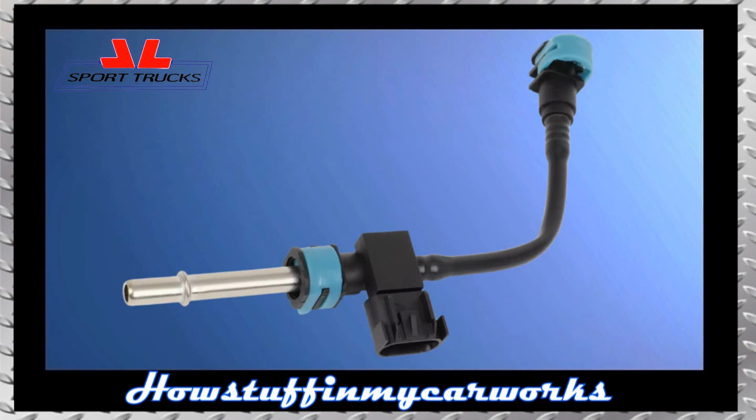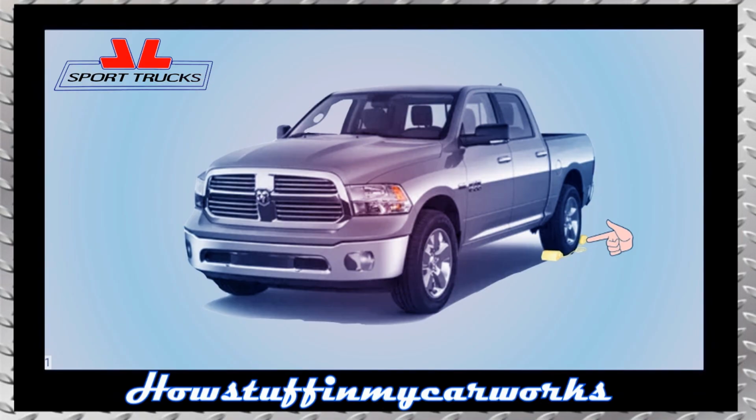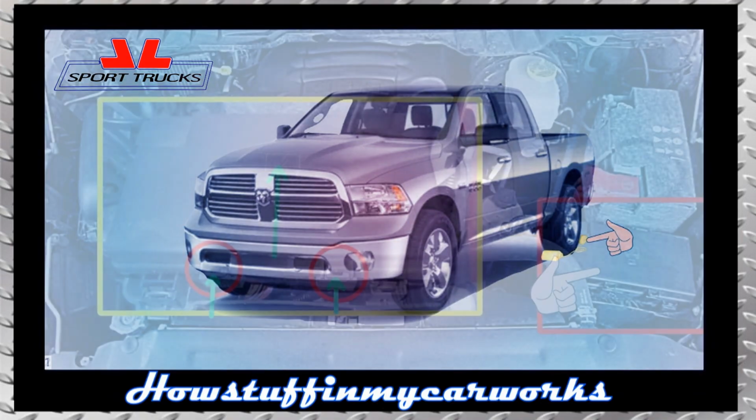In this video I will show you how to replace the fuel pressure sensor on Ram 1500 pickup trucks equipped with 5.7-liter Hemi engine. Step number 1. Park the truck on a level surface, engage the emergency brake and place blocks in front of and behind the rear wheels for safety.